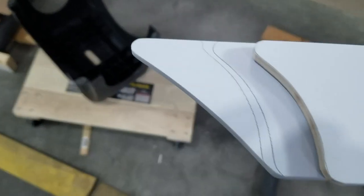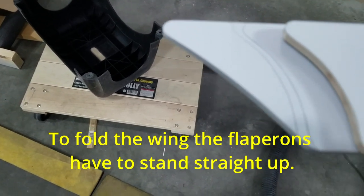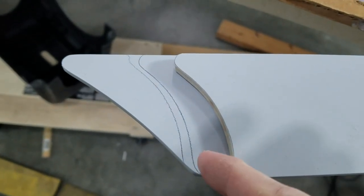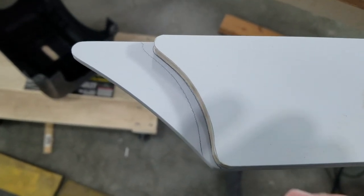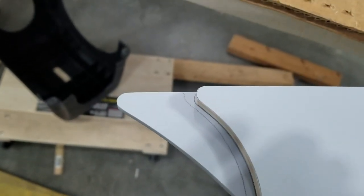We're working on the stall fences that go on the wing. They don't tell you in the book that your ailerons will not fold up with the original shape. So I just took mine and held it up against the green wing tips and marked them off there. I started right here at the corner and then cut them off to match, and it's got the same shape now as your wing tips out there — getting rid of this right here will allow it to fold up.